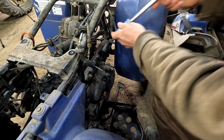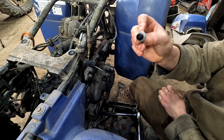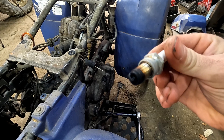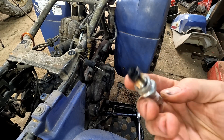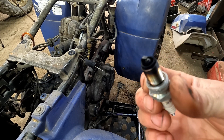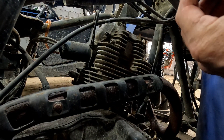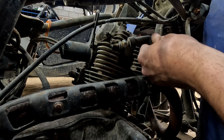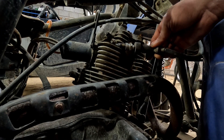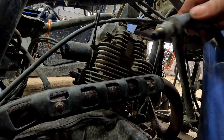The spark plug looks fairly normal. It's an NGK, so it's a good plug. I'll clean the point up a little bit and it should be good. We'll check to see if she's got good spark. I've got the plug getting cleaned up, the battery in, and I'm going to check for spark — hopefully not shock myself. Beautiful spark! There's half the battle right there. I'm going to throw this plug back in.